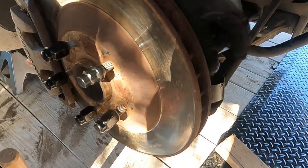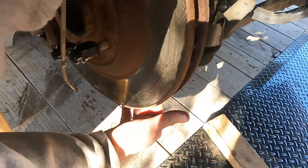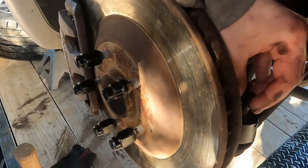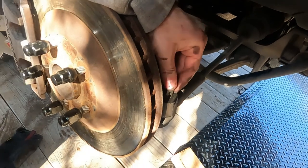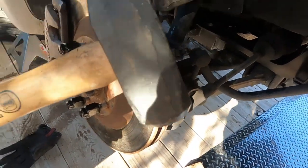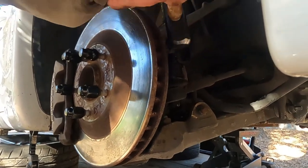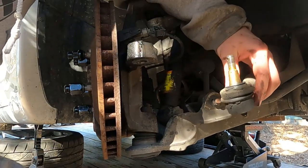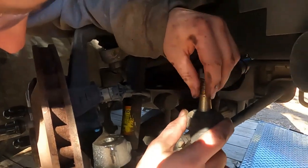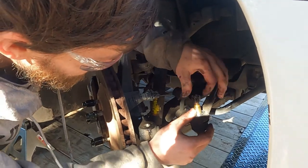To get this out, what we're going to do is take this nut off and flip it over — drop it — then screw it upside down on top of the tie rod. If you tap it again, there you go. Now that we've got that nice and flush, we're going to take our mallet — you can use a rubber mallet — give her a few whacks, then take off that nut and hit it right off. Boom. Inspecting my tie rods, this one is actually better looking than the other one, but I need new ones. There we go — now we move on to the next few steps.